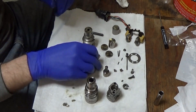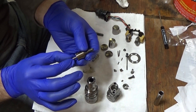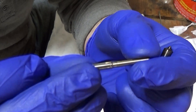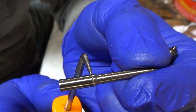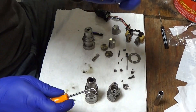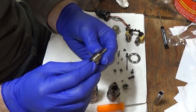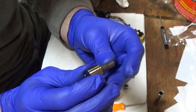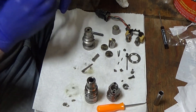Now we'll check our injector nozzle, our needle, our plunger, and make sure it slides in and out. It'll get stuck a little bit — if you look, there's a little line right here. It's just a raised area that they leave from machining. It probably acts like a seal so fuel doesn't come back up that needle. That'll catch when you're going in with it, a little tough. But that needle feels good and it comes right out.